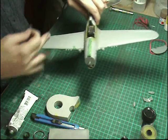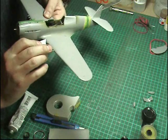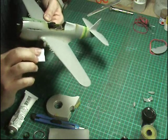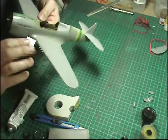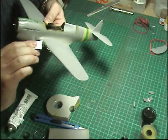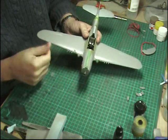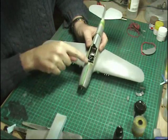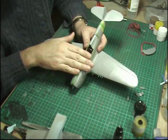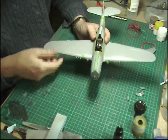There we go — we're all ready. It's the evening now, so this will sit overnight and be ready for the morning to go around and take care of sanding. By leaving it a good 12 hours to go off it will hopefully be totally hard and very easy to get in there to do any work we need to do. Here we are next morning — filler is all totally dry. This is the best way. The thing is if you try and sand it when it's wet, or it's dry on the surface but still thick underneath, it just pulls and drags. The best thing is to really let your filler dry for at least 12 hours, even if it's quite thin — that way it'll save you a lot of trouble, otherwise you'll just be dragging it clean out again.